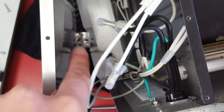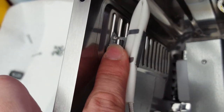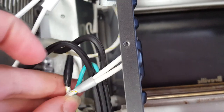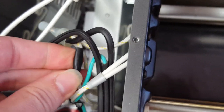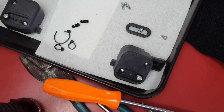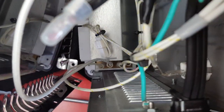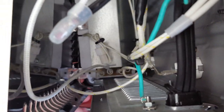I'm sure you guys are sick of looking at the back of this toaster like I am. I'm going to try and get those two screws back in somehow, and then I think I'm just going to do what that other guy did and secure the fuse through one of the vent fins on this side, so it's away from the heat. I'm not going to bother zip-tying any of the wires back together. I did put electrical tape around the frayed fabric where I accidentally cut a zip tie. There were like five zip ties in there — why are there all these zip ties? Everything is pretty self-contained, so they just got in my way. If I have to do this again, at least I won't have to cut zip ties.